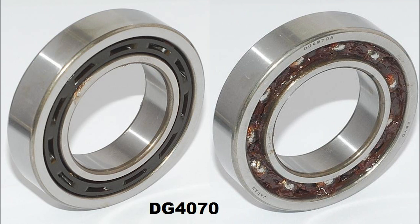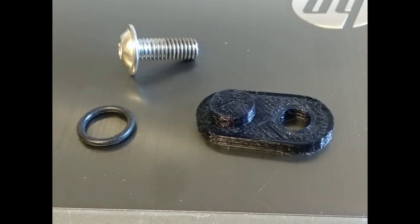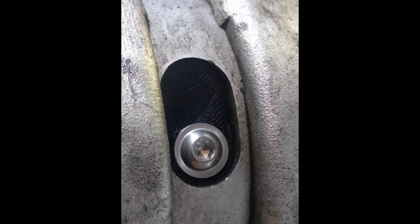No need to make an adapter or a sleeve, these two will fit right in. Believe me, I've ridden with them for the last 10,000 kilometers. The speedometer won't work as these bearings don't have a magnetic ring that would cause the sensor to generate impulses. Remove the sensor and close the hole with a plug. I made myself a 3D printed version.